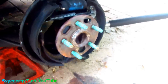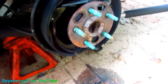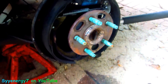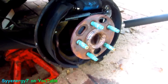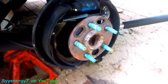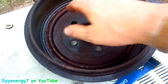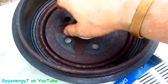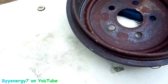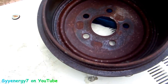You can use brake clean. I always use starting fluid for everything because it's cheaper, but it cleans real good. Use the wire brush on here, all around in here. I don't even want to touch it because it's really chemically clean - scraped it off with the scraper. So I'm gonna hit that with a coat of rust-killing primer and let it dry. Same thing with this - hit it with starting fluid, put it in front of the fan, let it blow dry, then bring it inside. I scraped all around in here, got the rust off.